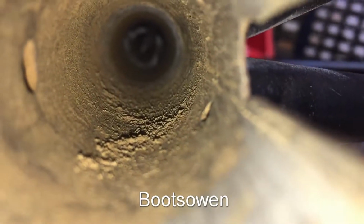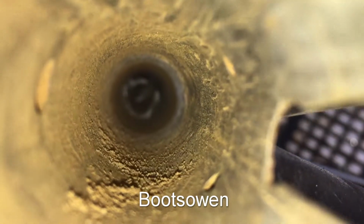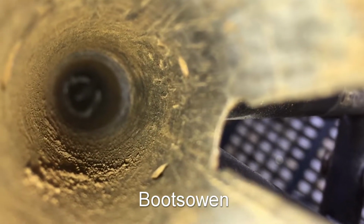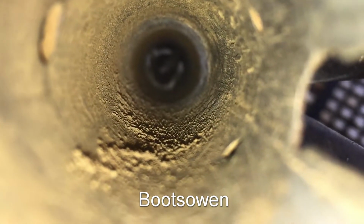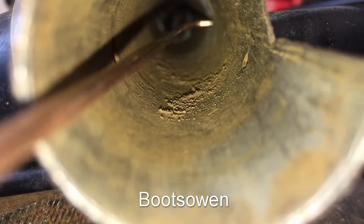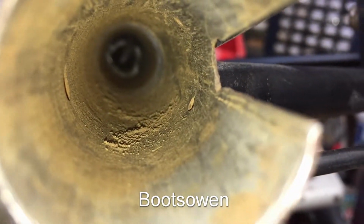So looking into the pipe again, I've given it another clean with the brush, and you can see on the right hand side of the tube there's a bit of a grey haze, and I think there's an aluminium corrosion issue there that's a bit lumpy. So I'm going to try and scrape the inside of the pipe a bit. I've pushed the seat post right back down to the bottom again. But just there at the tip of that welding rod, there's a bit of corrosion, and I think it's causing a constriction.